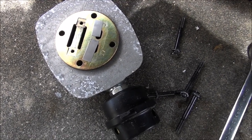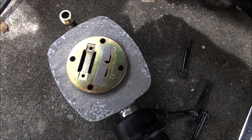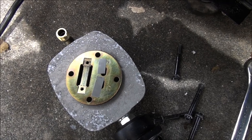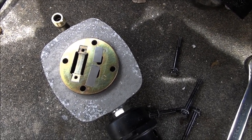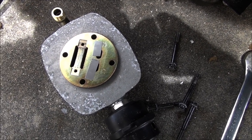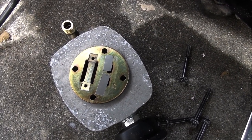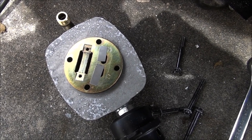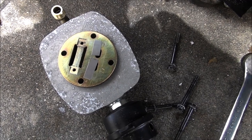And I don't want to wait. I want to get this puppy up and running right now. So I'm watching videos on YouTube, and a guy on some island had the same problem. What he did was take an old metal hose clamp, just your regular type hose clamp, flatten it out, cut it, and sand it down to match the broken reed valve.